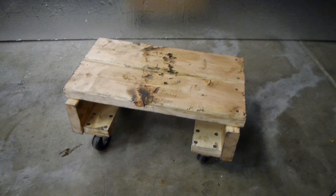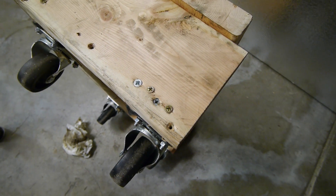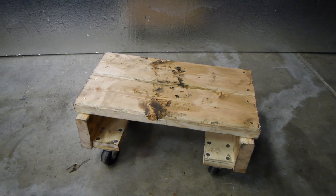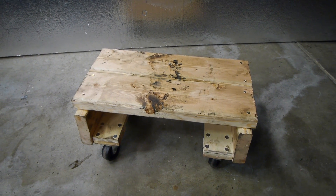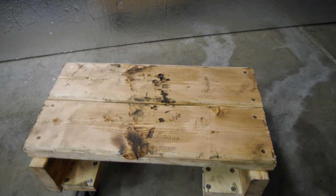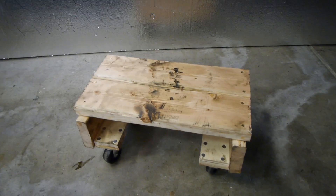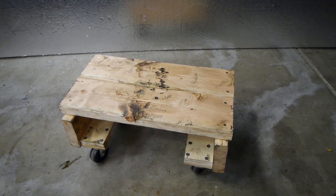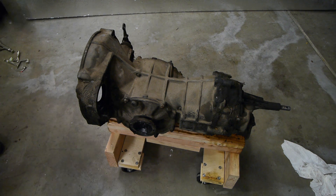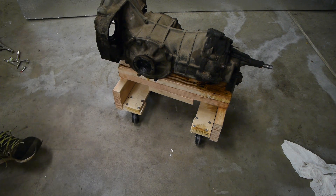Aftermath of using this a bunch — one thing I did notice is that it was creaking on the sides a bit where I only had four screws. So I added a bunch more just for structural integrity, because that's literally where all the weight is sitting. It barely fit in — it might be a little bit wide, but it definitely worked. If I was going to do it again, I might add a couple of support boards this way just to help cradle the engine in, because you definitely had to keep a hand on it because it was a little tipsy. But overall it worked out for what I needed, and for 12 bucks total build cost, can't go wrong. And if you want to make one for a transmission, same thing except just stack the two boards vertically, because it's got to be more narrow to fit up in between the support beams underneath the bug.